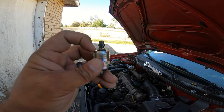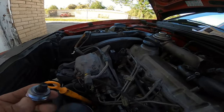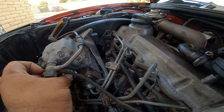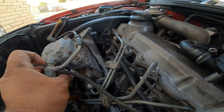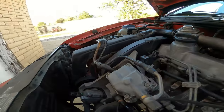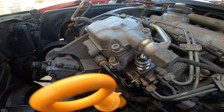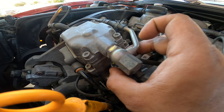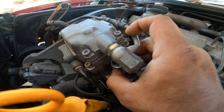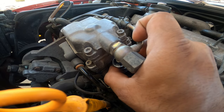You can hear me pressing on the brand new plunger. There's a new O-ring on the inside. Be very careful when you drop it in — make sure it goes in nice and centered. It has to fall into place. If it doesn't fall into place, it will not seal correctly, and you risk damaging the plunger or the spring. This is where you'll want to twist it by hand as far down as possible before you even introduce the wrench, because you can damage it.